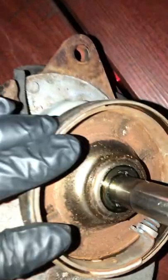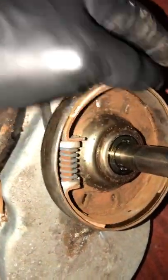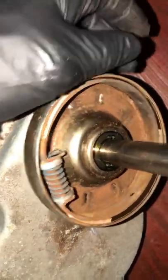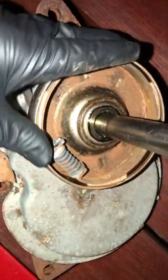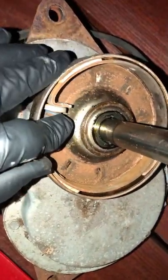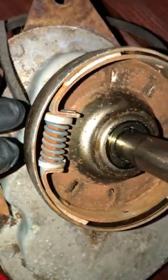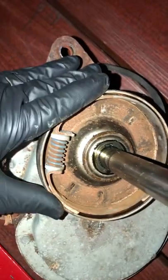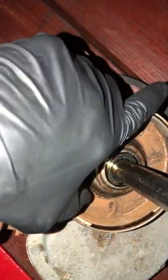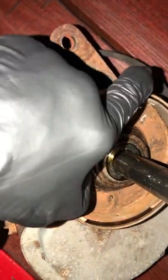It will drain but will not spin. Also, if your clothing is coming out wet — the washer agitates but does not spin, it drains the water but does not spin — you might want to check your clutch. This is a clutch assembly.